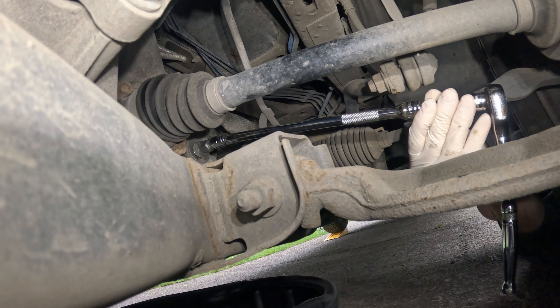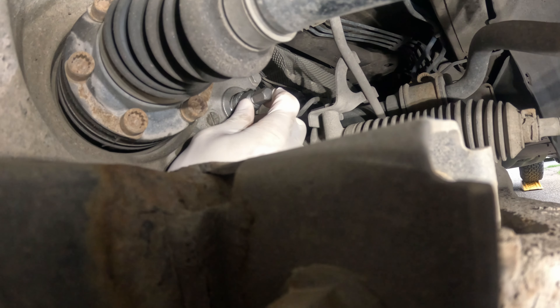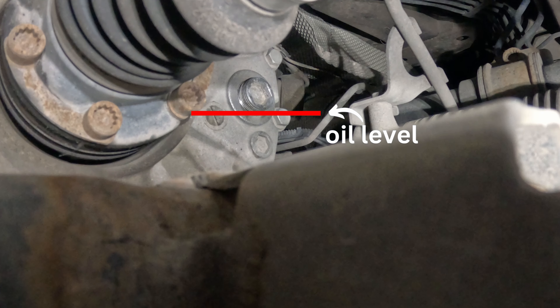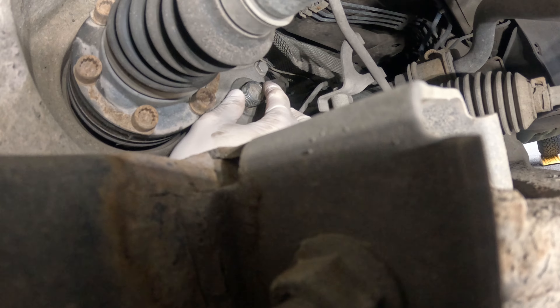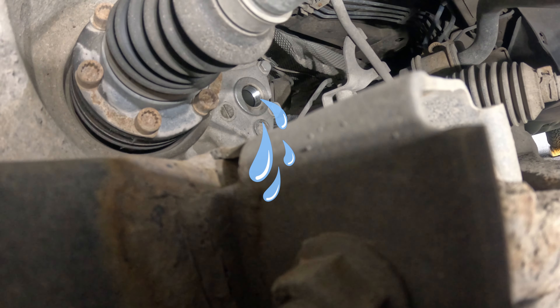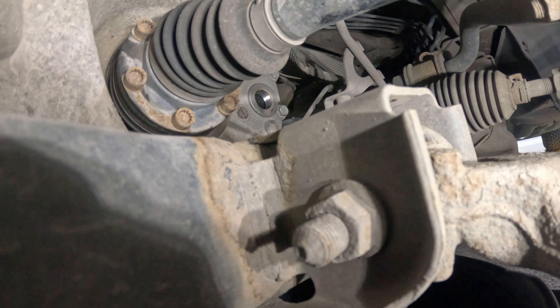As I said before, try to undo your filler plug first and make sure you can fill it up before you drain your oil. This is where your maximum level of transmission oil would be when filling it up — when the oil starts to drip out of that filler hole, you know your transmission is full. Just as simple as that.